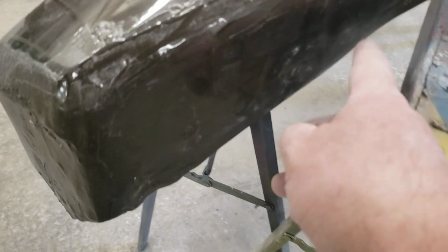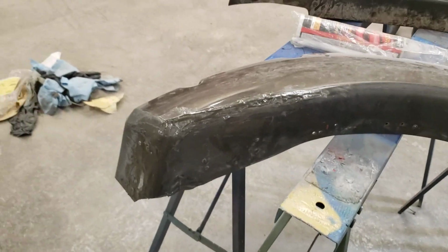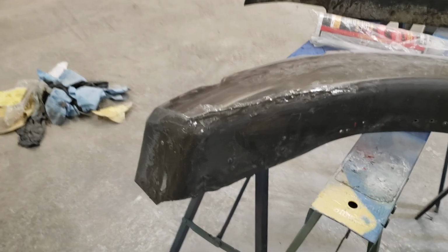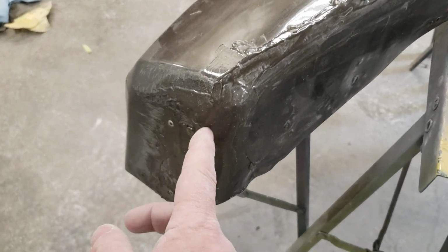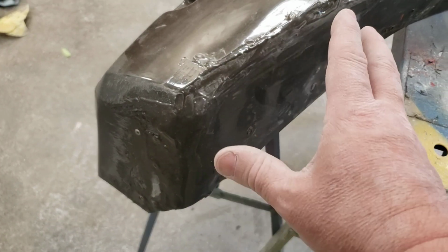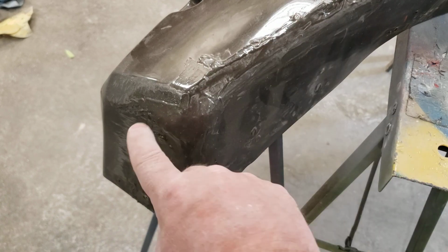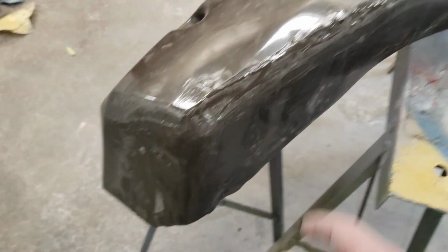Mud flaps go in here, which is good because there's some holes. I fixed some, but not all of them. You can see down here. So I made this super rough. And people wonder what to use. A lot of guys will use that 5-minute plastic epoxy. What I did, when I relieved this, I left the extra material. I didn't chomp it out. And I pulled this in and riveted it tight together between the 2 layers of plastic.